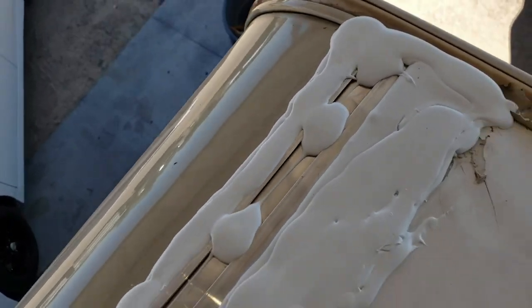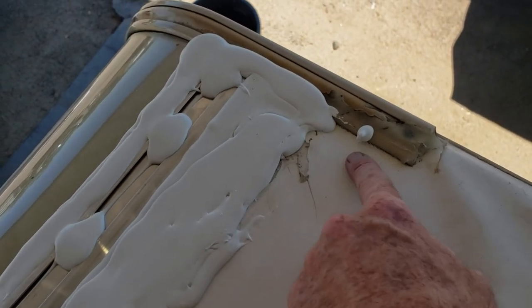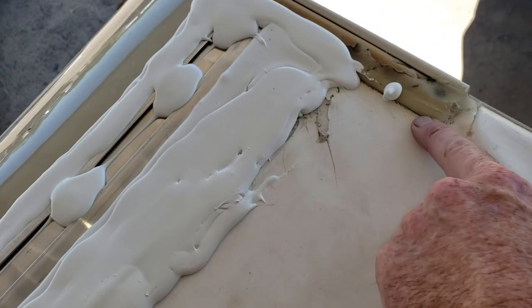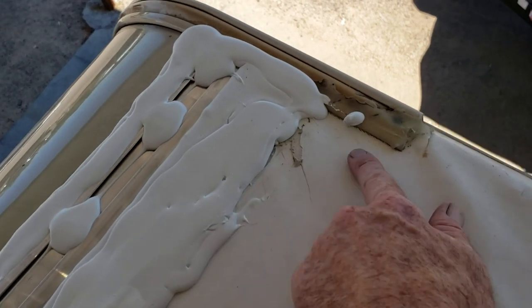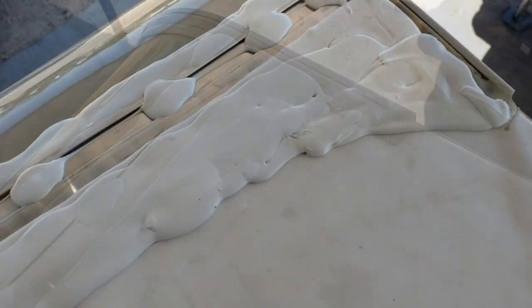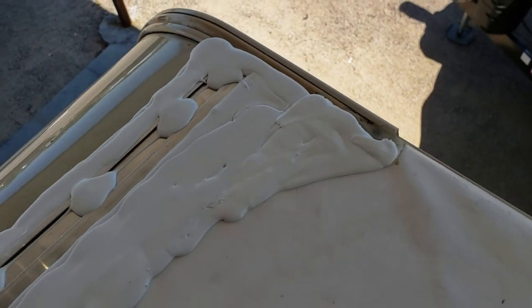Even if it's not this job specifically — if you ever see a roof where the molding has this gap right there — what I like to do is completely fill that void or radius. That way when water comes across it doesn't pool right there. The sealant keeps it from pooling and makes it go over the edge. Pooling water will get underneath no matter how well it's sealed, so this is what I recommend doing.